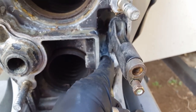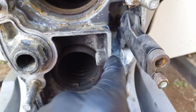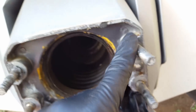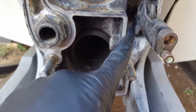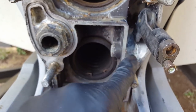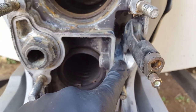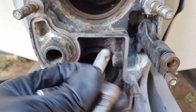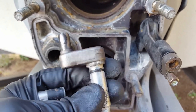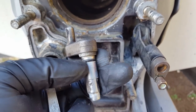One thing to notice: if you've got a lot of corrosion — more like a buildup you'd see with excess calcium — there's a seal around the surface here that blocks off exhaust water. In theory this area should be watertight. If it's not, chances are the seal around what's called the bell crank is no good and you'll need a new bell crank seal.